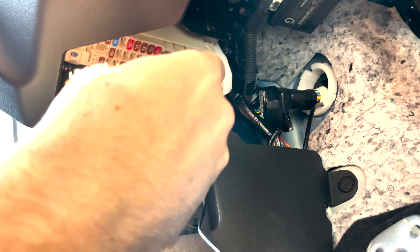Now running the rear camera wire. The rear camera cable has a straight end and a 90-degree end - the straight end goes to the head unit side and the 90-degree end connects to the rear camera for a cleaner look. We route it up and along the headliner. There's excess wire to deal with, so we'll get creative tucking it into the B-pillar or a panel so it doesn't rattle.